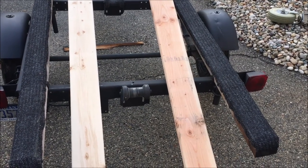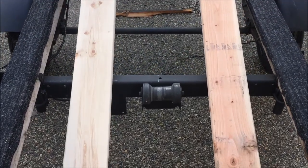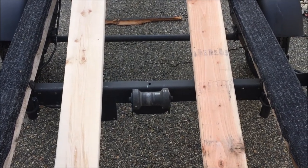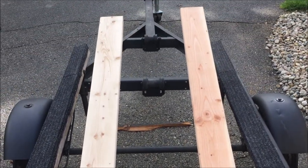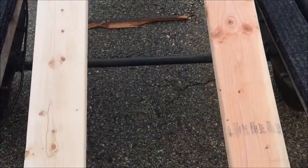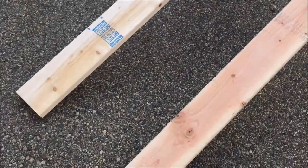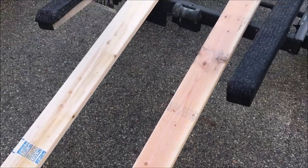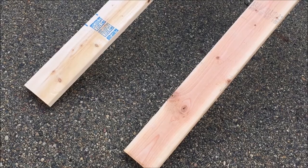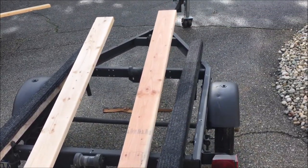The sport boat is nearly flat and I measured it — what I want now is 30 inches from the outside of one board to the outside of the other. I'm going to take these two 2x6s, put a piece across the front edge, and mount hinges in the back so when I'm loading the boat the bunks will tip down. Gravity will be my friend, dropping the bunks to make it easy to load a boat from even the most shallow ramp.